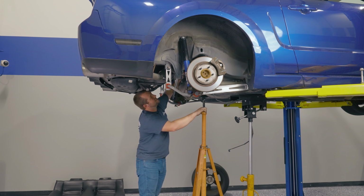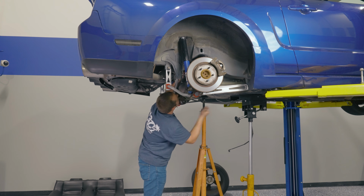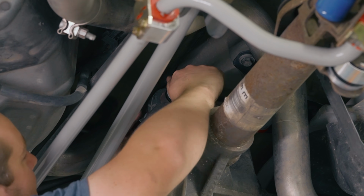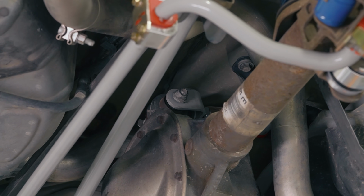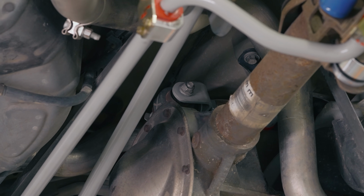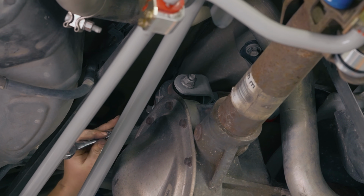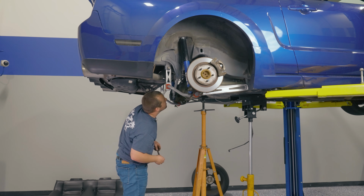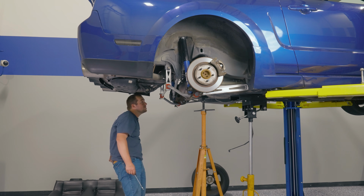So in order to get it into place, you may need to move the differential up or down a little bit. Now keep in mind there's a flag on the head side of this bolt, but it's got nothing to catch anymore. It was catching on the factory upper control arm. So you're gonna have to get an 18mm wrench to go along with your impact to hold the bolt in place. Now we tighten up the gas tank, and after that we go into the rear seat.